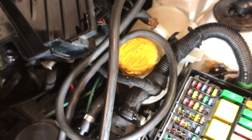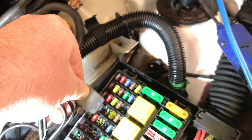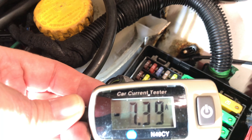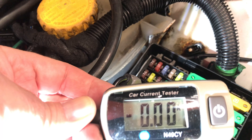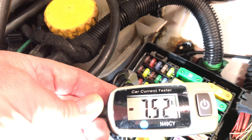So obviously the fuse fairy's been here again, as Steve Scott would say. So I'm just going to feed it and see how many amps it takes — I think it'll either be 7 and a half or 15. Here's a little gadget I use quite often. So let's see how much it draws — it's kind of peaking at 8 amps, so probably a 15 amp fuse would solve that. It's roughly half, so we'll pop a 15 amp fuse in there and I think that'll be done with it.